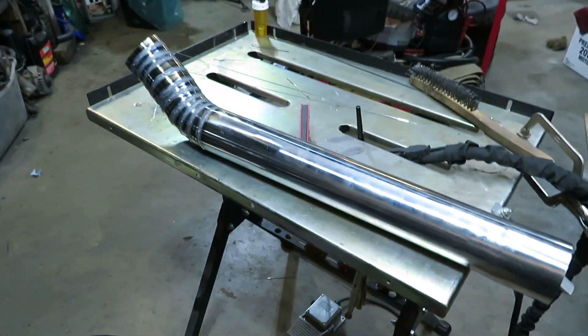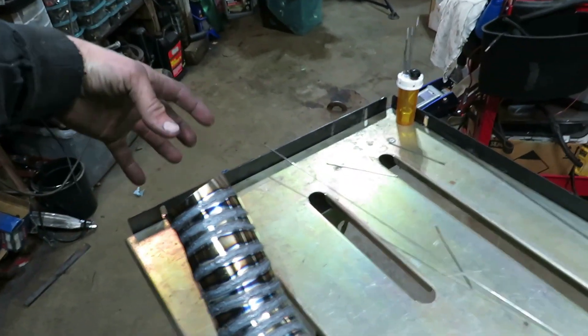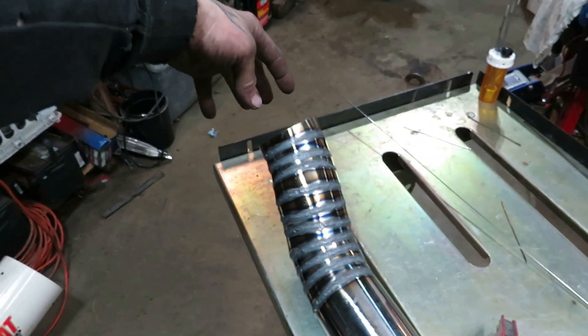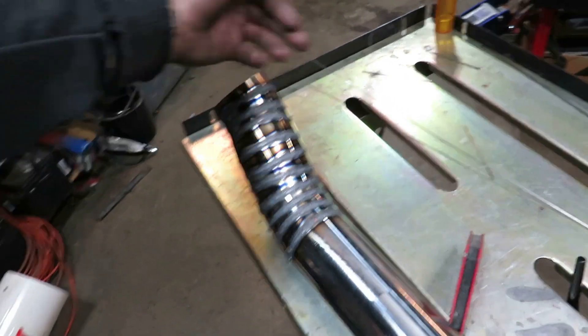This is the driver's side, so I've got the other flange that bolts to the header still in there. I'm going to go in there, mock it up, tack weld it, then unbolt the whole thing and drop it out, and then I'll finish weld the top half of it. Passenger's side.